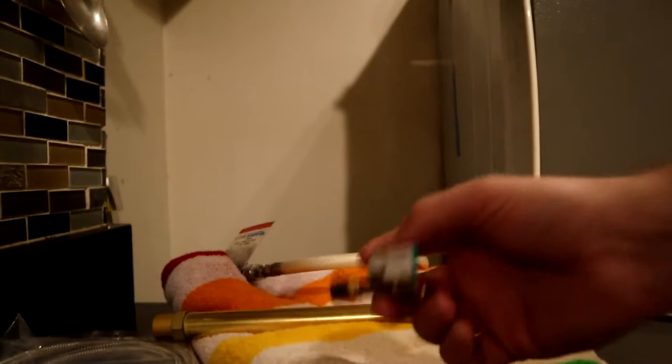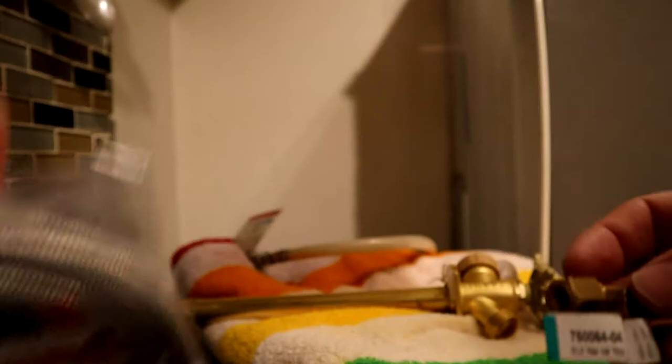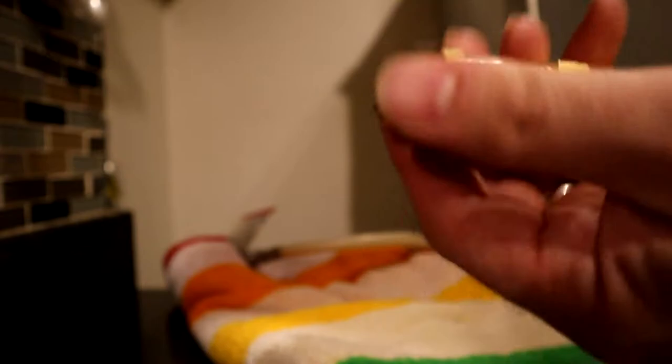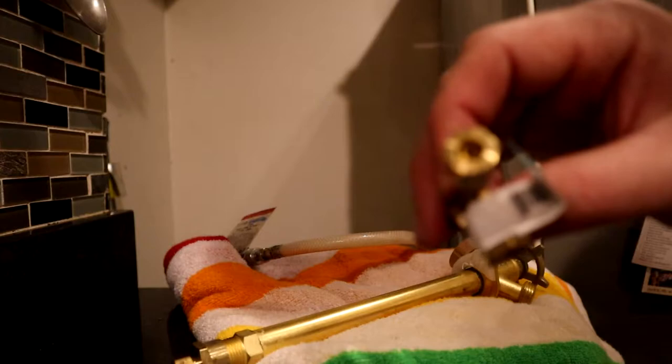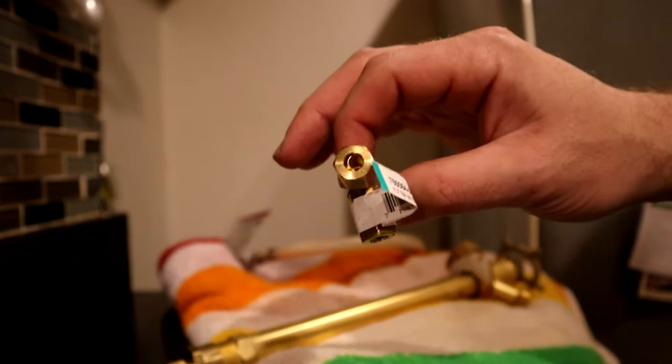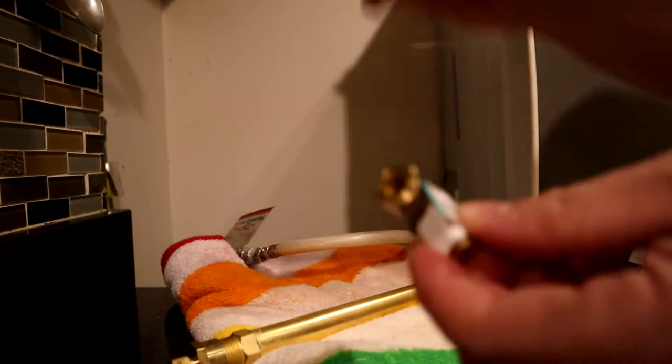So I bought the T-adapter so I can have that come off — T-adapter to another hose which will still go to the ice maker. The other T is going to go to this other hose which will then go to the wall, get put into this quarter-inch to half-inch converter right here and screw on to the end of this silcock. Now if you do a project like this at home, keep in mind that compression fittings — which are these ends on the end of the ice maker line — a compression fitting for a quarter-inch is a different size than the standard quarter-inch NPT or FIP. There are multiple different sizes of these things and it's very difficult to find the right stuff. I need to go get a crescent wrench. We're gonna hook this thing up just to run it before I start drilling holes in the wall, to make sure this would even have pressure to make this worth it.